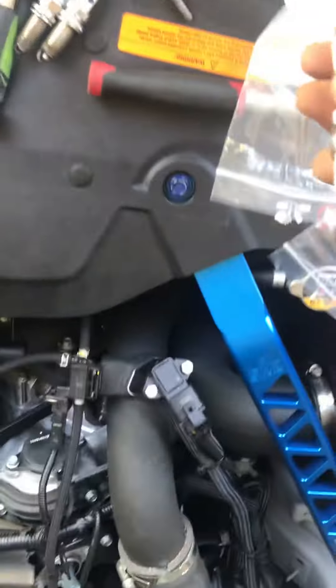So I'm going to put the OEM back on cylinders 2 and 6. These are the ones that were in there - the Denso. I don't think it'll make a difference. This is the other bad one - as you can see the tips are almost gone on these if you put them side by side.